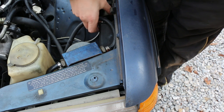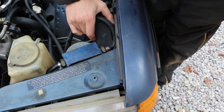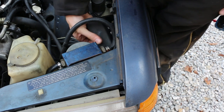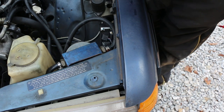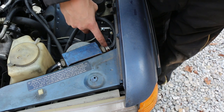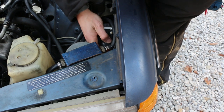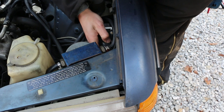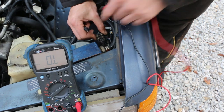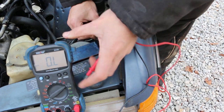Down in here we have our glow plug relay. Pop this little cover off — it just kind of slides up out. My fuel filter is in the way there because I've added an extra-large filter to help with the fuel quality in my county. You'll notice there's two plugs on here: a little upper one and a big lower one that's really difficult to see on camera. Take that bigger plug off — it just pulls straight up, no clip or anything. So we've got five populated holes here, and we're going to use our multimeter on ohms range.